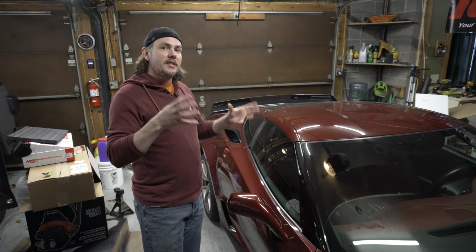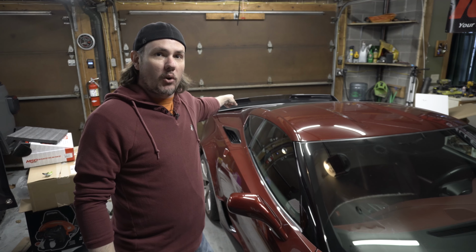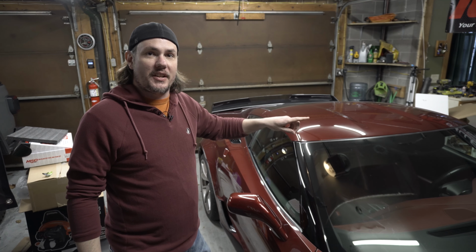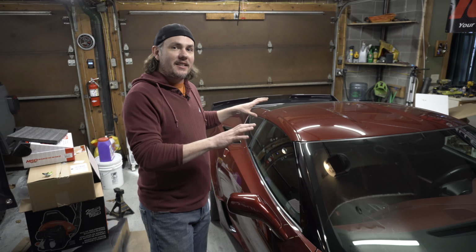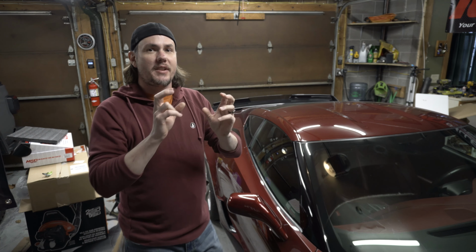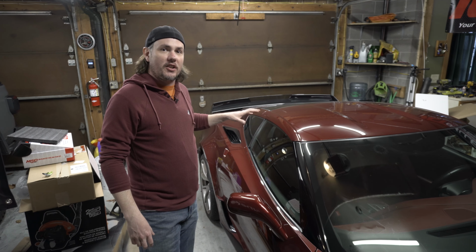Double check the orientation of your clamps that you're using though, because they may be bolts out on the rear ones and then bolts in on the middle ones, etc. Don't get everything tightened down too much before you make sure that you can rotate them out of the way, and remember to have clearance for your underbelly skid plate whenever all is said and done.